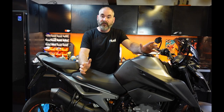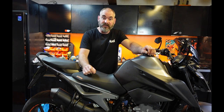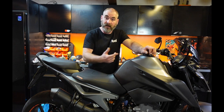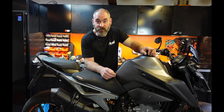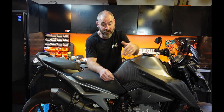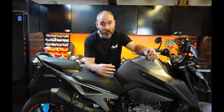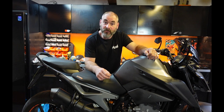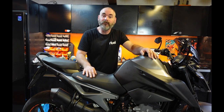Dry as a bone! Thankfully I've been able to sort the leak on my bike. There has been an issue historically with coolant leaks on KTM Duke 790s, which I managed to avoid up until now. The only obvious place for coolant leaks is the two pipes either into or out of the radiator, and it may be something as simple as swapping the jubilee clip over. Thank you for watching. If you might have a coolant leak on a Duke 790, I hope this has been useful. Don't forget, if you want a Bolt Hole Biker sticker, drop me a line. We went past 2,000 subscribers a couple of weeks ago - thank you very much for that. If you're enjoying the channel, consider hitting the subscribe button. That's it for this one, see you in the next one, bye!